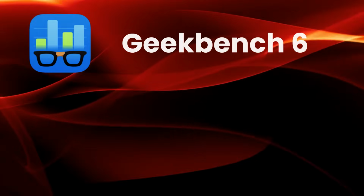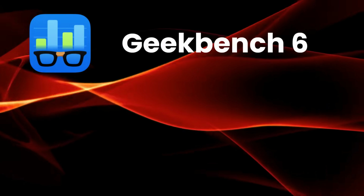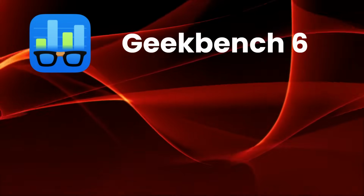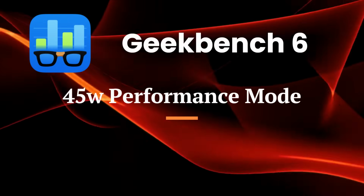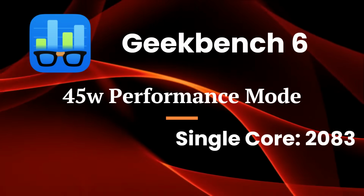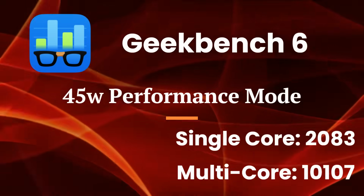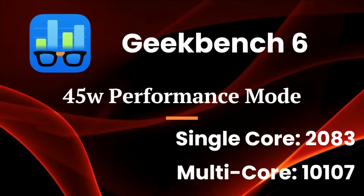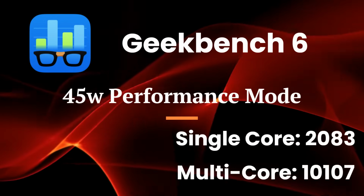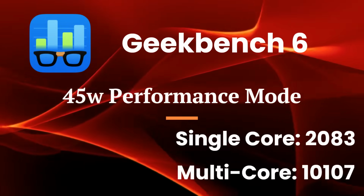For all of my benchmarks, I have the PC using that performance mode toggle, which caps it at 45 watts. Let's start out with Geekbench 6 and see where the 6900HX stands. I always like keeping reference for future comparisons as well as giving us an idea of how it might perform. For the single core score, the 6900HX scored a 2083, and for the multi-core score, it scored 10,107, which unsurprisingly is higher than any 6800U device I've tested on the channel, given that we are dealing with more power here.